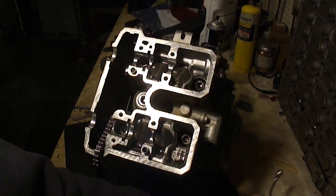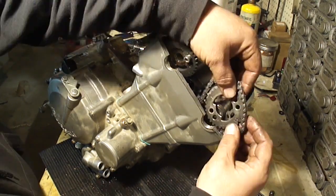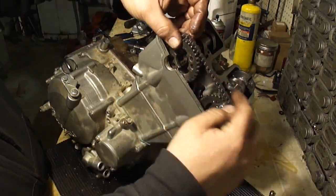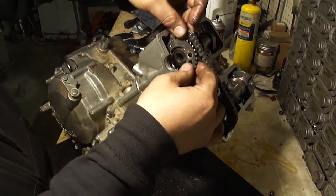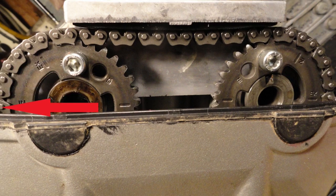Let's get the camshaft set back in here. I'm going to pull all the slack on this side and line up the exhaust marks. Same thing over here — pull all the slack from this side and line up the intake marks. Now you've got to count the pins between the exhaust mark on the front and the intake mark on the back. 32 pins is what you need to get. So you're going to start here: 1, 2, 3, 4... all the way around... 29, 30, 31, 32. And that's how you set the cam timing.